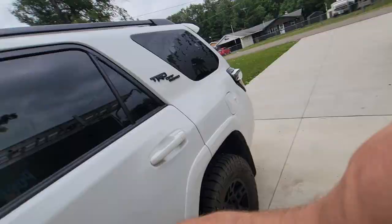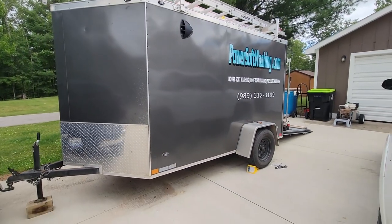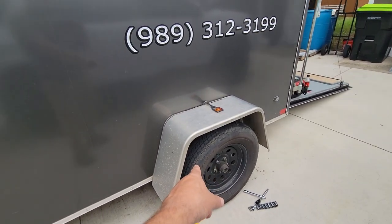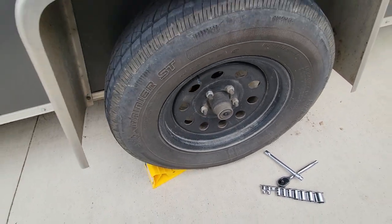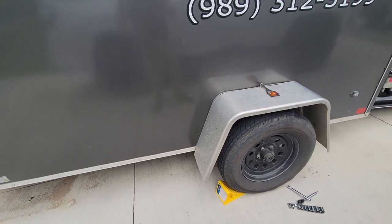There's no two ways around this — when you have a trailer, you have to do the maintenance on it. The beauty of this trailer, and there's a reason I chose it: if you have tandem axles, you now have four tires versus two tires, brakes, an electronically-controlled brake box — two sets of brakes you have to mess with. The more expensive and bigger you go, the more stuff you have to regularly deal with. For me, I maxed this trailer out right at 2,900 pounds, which gives me just two tires, one axle, no brakes, and redoing the bearings.